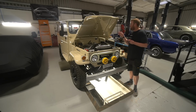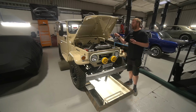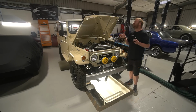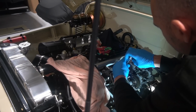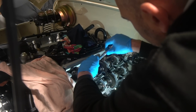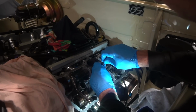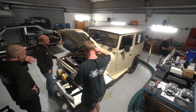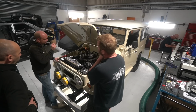And then we started to think it could just be the cam belt squeaking against the side of one of the pulleys. So we decided to run it for a while, but it didn't change at all, which was bizarre. Kind of put our brains back into it again. It definitely sounded like it was at the top with the stethoscope. It was most noticeable around the cam pulleys. But it seemed to flitter around, and it came and went, which was odd. Sometimes it was a bit this side, mostly this side, but you'd almost convince yourself it could be on all cylinders.